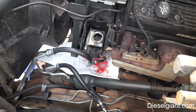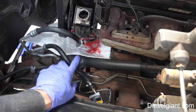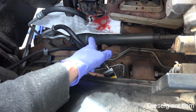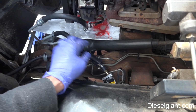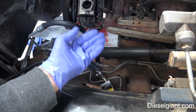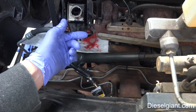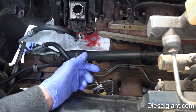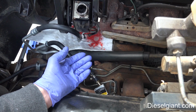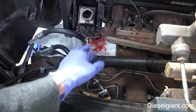So the next video I'm going to do, I'm going to show you how to install a filter. Since I already have this off, that'll be another video, but I'm going to show you how to install a power steering filter in the return hose so you can keep any debris that accumulates in the fluid from the time that you flush it from flush to flushed. It's a magnetic filter.